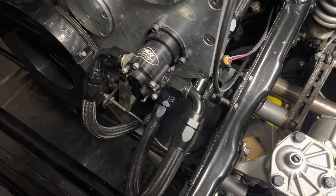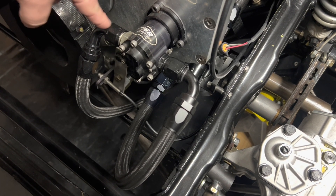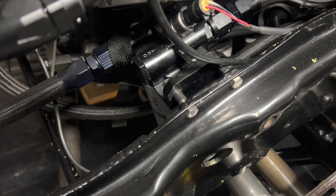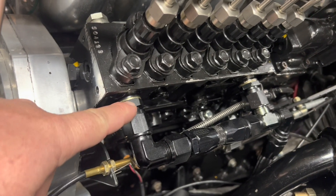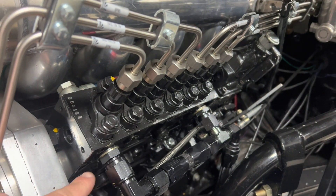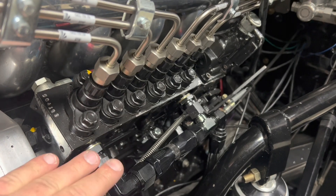Now let's check out a mechanical fuel pump on a P-pump. This is a DSR pump, but it does the exact same thing as a Waterman. You've got your fuel supply coming from the tank on this side and then the high pressure line on this side. The high pressure line goes to the same style Earl's 2077 filter head as we ran on the common rail engine. But from there it simply goes directly to the injection pump. The way I did my injection pump, I'm dual feeding both of the side ports. I know some guys dual feed from the front port, but because I have an air throttle setup, I'm able to dual feed it to the side, and I believe that to be the best way to do it.